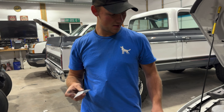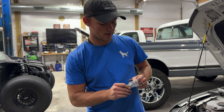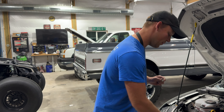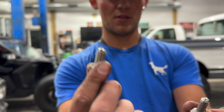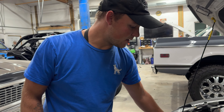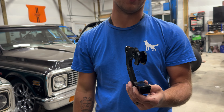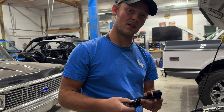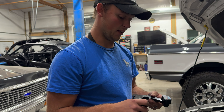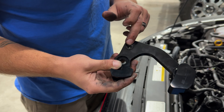With our supplied rods by CTS — there are two different sizes, bigger and smaller — that depends on if you are Volkswagen or Audi. There's a very noticeable difference in that shifter bushing size. Smaller guy it is. We'll set this on there first — importantly, your other shifter arm that is vertical actually rotates and slides through this, so make sure when you're putting it on you get that lined up, otherwise you'll be stuck in third and fourth. This is going to be our 35% reduction option.